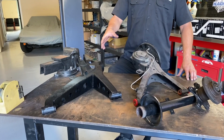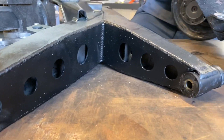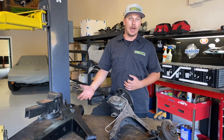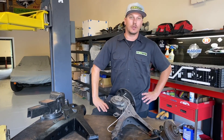These plates I've actually designed in-house. I've done a BMW 1602 and done the same swap for a conversion on that car as well. So we actually had these plates cut out, welded them in, and we've gone ahead and made the mounts on the car.